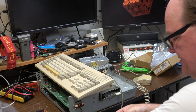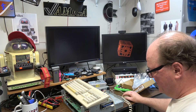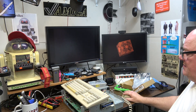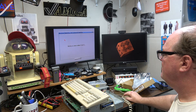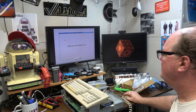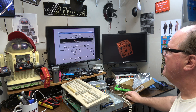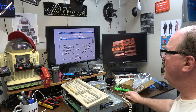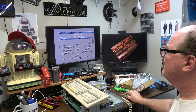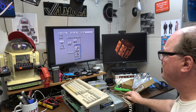My actual disks — I just need to install so I can get HD Toolbox. Hopefully this disk is still good. I haven't used it in 30 years. It's not even 3.1, it's 3.0, but I need HD Toolbox. Does this drive show up? Partition drive — there's one 116 meg DH0 partition on here. Quantum LP120S.